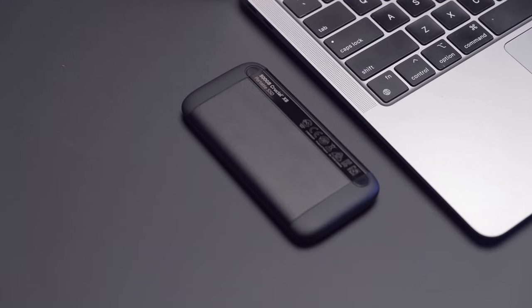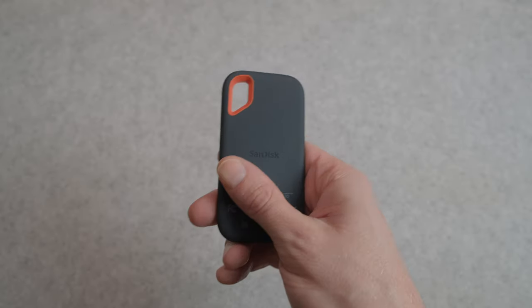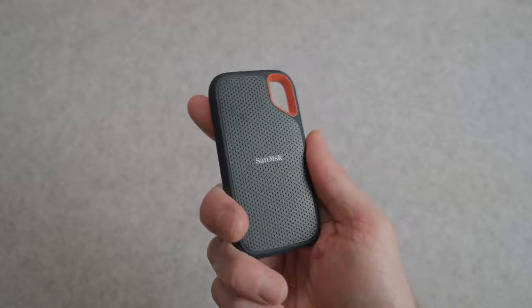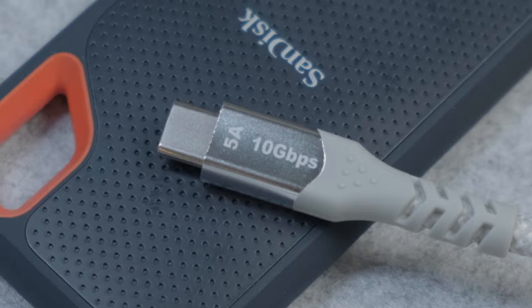Some things to be aware of though, just be careful which external SSD you buy. I think a lot of these external devices are made more for casual storage needs than anything, so turning this into a drive that's constantly working generates a lot of heat. And while it is way cheaper to buy a drive like this initially, if you don't choose the right one, it can end up costing you a little bit more. I had one drive that seemed like it was dying on me, which was the Crucial X8, and I switched that to the SanDisk external drive and it's been great. I'll link it in the description below along with everything else that I use with my Mac Mini, but there is one more thing to note here. The SanDisk drive that I have here is a USB 3.2 capable of 10 gigabits per second.